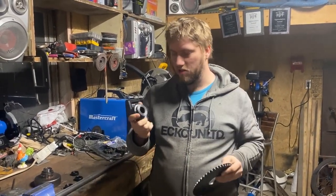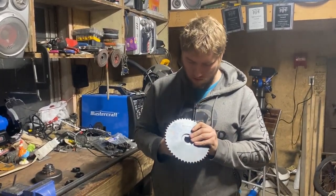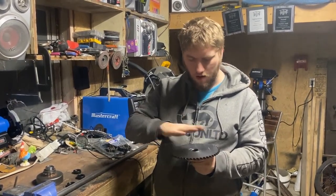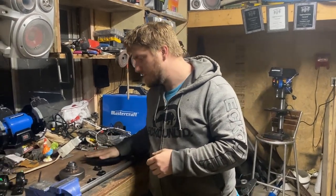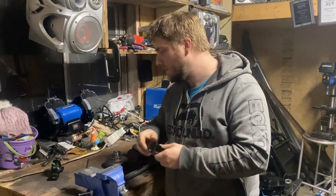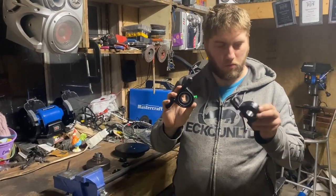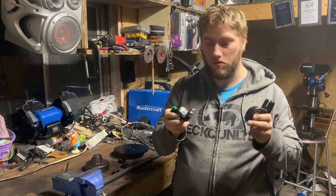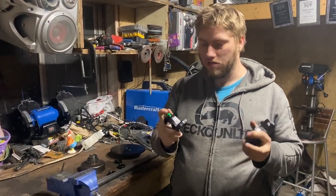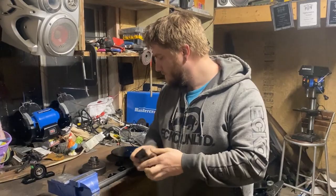And to get this to pair up to the shaft perfectly, we have a 1-inch bore sprocket hub. So we are going to place these together, do a weld bead around the back, weld bead on the front, grind it nice and smooth. And then lastly, to make sure that the shaft spins and doesn't hit anything, to actually mount it to the chassis of the lawn cart, we've got some 1-inch bore pillow block bearings, which are serviceable, so should they start to get a little on the rusty side from the mud or the snow or whatever we're hitting, we can just grease up these nipples and keep the fun rolling.